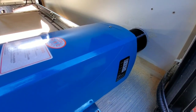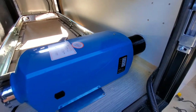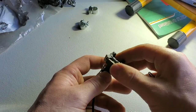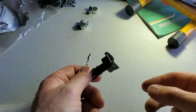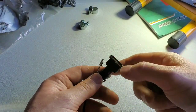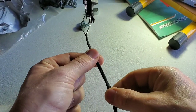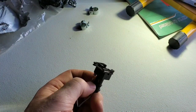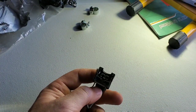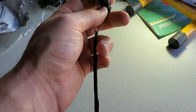Something to think about — maybe I'll try it without clamps, but probably I'll put the clamps on. If you have them you might as well use them. Here's something a little bit difficult I want to show you — this is the connection for the fuel pump. Obviously I don't want to cut a hole this big when this little wire is all that's going through. I will need to cut a hole bigger because I do need to make some sort of grommet — you don't want this cable against the wood.